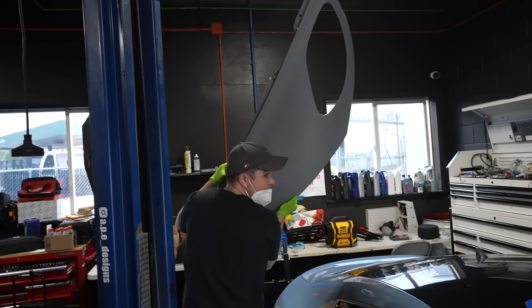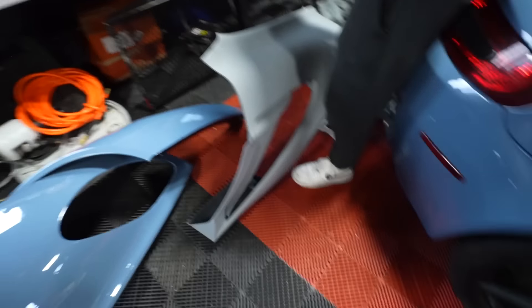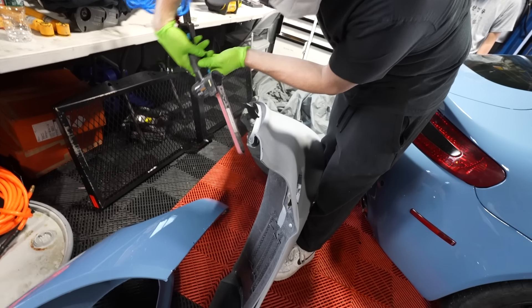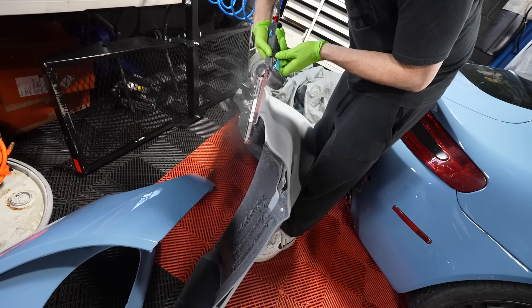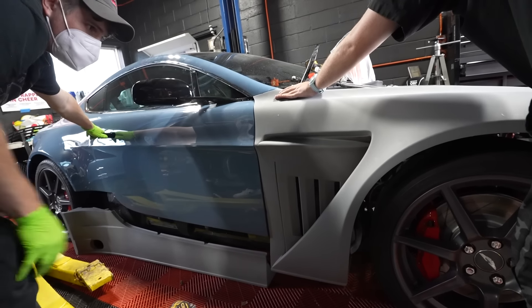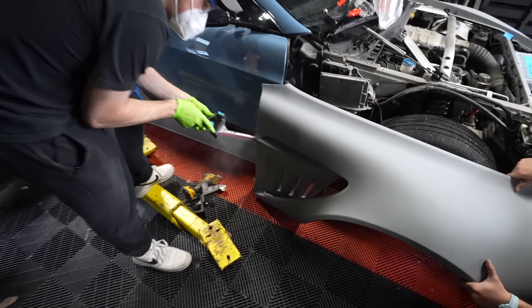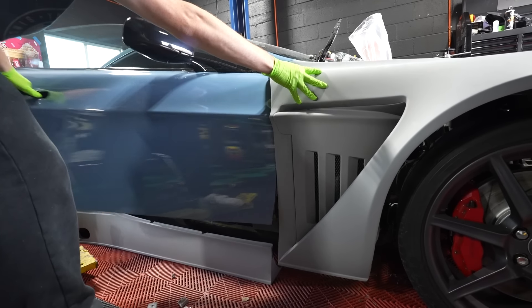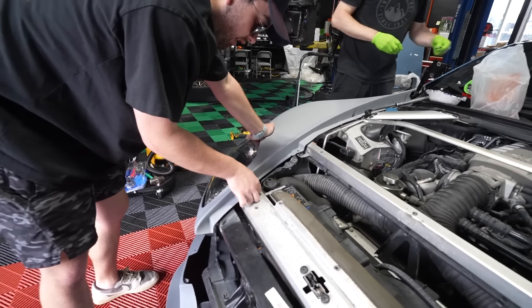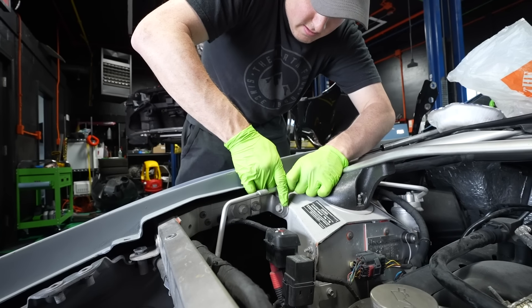With body kits like this, things usually just don't fit right, and that's definitely the case for us. Cheap fiberglass body kits, especially ones that aren't purchased frequently, are often made with fairly low-quality molds. This body kit has probably only been made four to five times, so the quality is lackluster at best, making all the panels slightly different and causing issues. In our case, it's causing the door to catch on the fender, so we have to do even more trimming with the belt sander. With the door fitting properly, we can bolt the fender down fully to its final position, which feels like a huge victory.